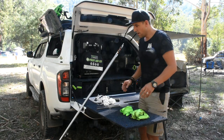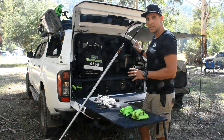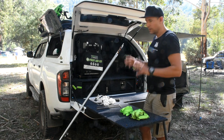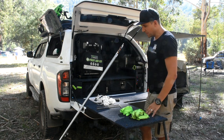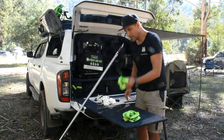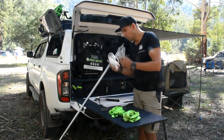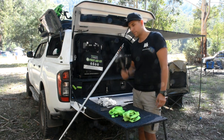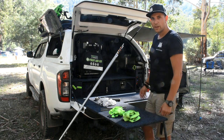I'm just going to show you the bits that you'll need, in my opinion, to make a really easy removal of the awning from your truck in a solo situation. You've got two guys it's simple, but doing it by yourself, here's what you'll need: two ratchet straps — I use green, Ironman green of course — three tent pegs, two guy ropes, two tent poles, and of course the old bang-bang hammer. I'll show you now how I get the awning off the truck.